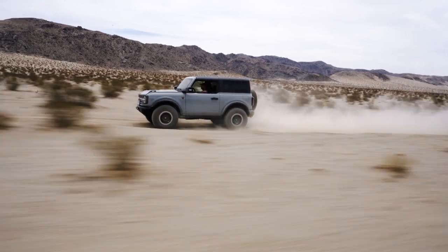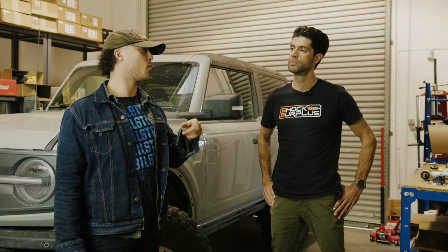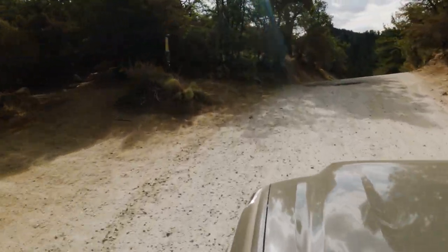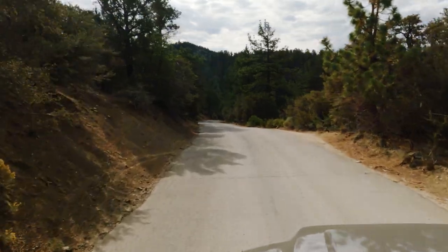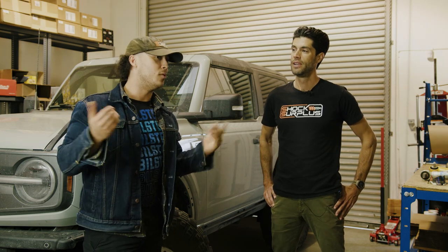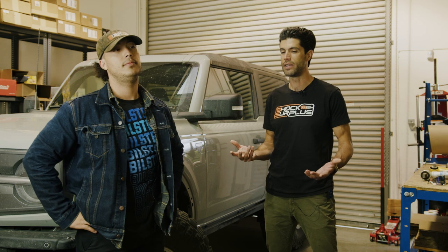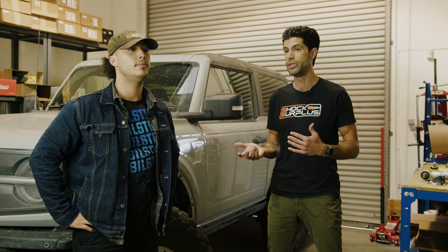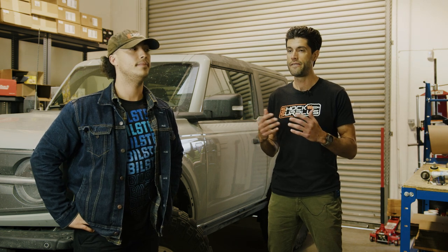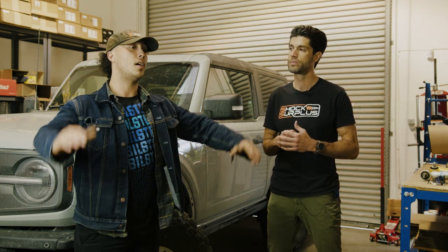We're talking about trail chatter — during testing from JV to Big Bear I was actually more comfortable going 40–50 mph down the whoop section than going 20 mph on the fire road to find a campsite. With the stock ESCVs, at the end of that drive I wanted to get out of the car so fast. With the 5100s I would have just been cruising, one hand on the wheel. With digressive shocks like Bilstein, the faster you go, the smoother they get — that's really obvious with a digressive valving setup. They're known for feeling a lot of chatter up front and then being very smooth at higher speeds.